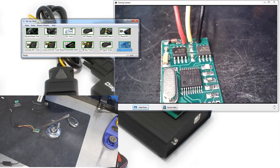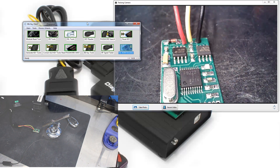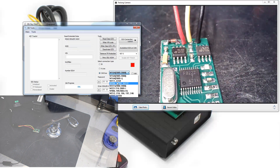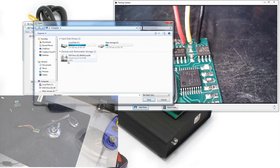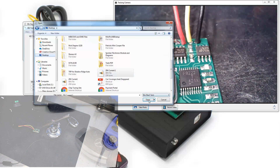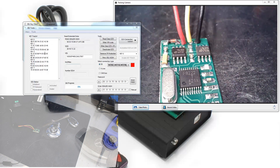At this point we're already assuming that you have done a password search of the key and have your password. Then we're gonna do the most current read of the EIS. I have an older file with a password in it — here's the password. This is a read but it's not current. Remember, if it's not current when you load and program it to your ESL, it might not respond because the current hash does not match up.